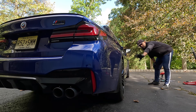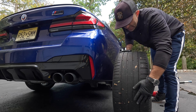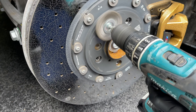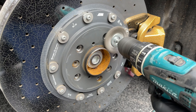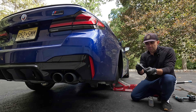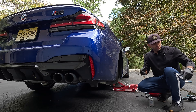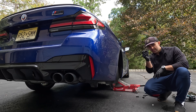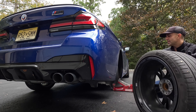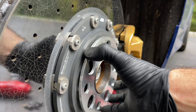I'm in a dilemma because I don't know if I should go with five or three mil in the back — I might try three. One thing you notice is that the rear tire doesn't have a lot of life left. I opened up the five, might as well use five. Now with the nature of this lip being so thin, I don't think I'm going to put anti-seize. I don't want anything splashing around. So I'm going to put the spacer on, then put the wheel on. With the five mil, you can still reuse the same lugs. I do not like how little lip you have with the five mil — I'm going to actually put a three mil just to be safe.